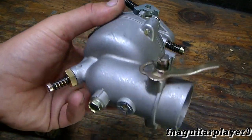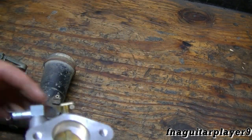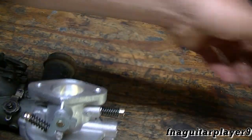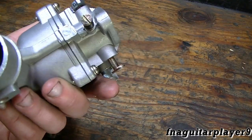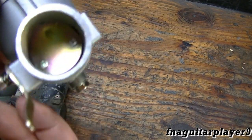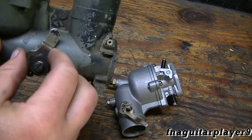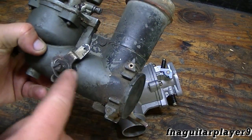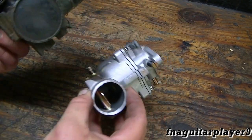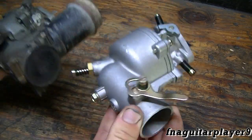It's still a good buy at $16 off eBay. One thing to note though: the holes in this are metric instead of standard, so the bolt that came out won't thread into this — you have to use a metric bolt. I don't feel like I'm out of anything because it didn't cost a whole lot. Another good point: if you need to work on your choke plate on this type, it ain't no problem — it's right there. But on this other type, you have to remove the Welch plug on the back to get access to it. You remove the plug and you're basically looking into it like that — that's just another difference between these two types.